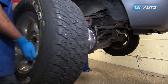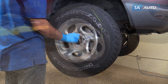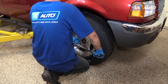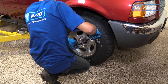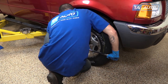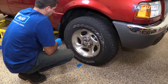Reinstall the wheel and tire and start your lug nuts by hand. With the weight of your vehicle on the tires, torque the lug nuts to a hundred foot-pounds in a cross pattern. Line up the tabs on the inside of your hubcap to the lug nuts and tap it back into place.